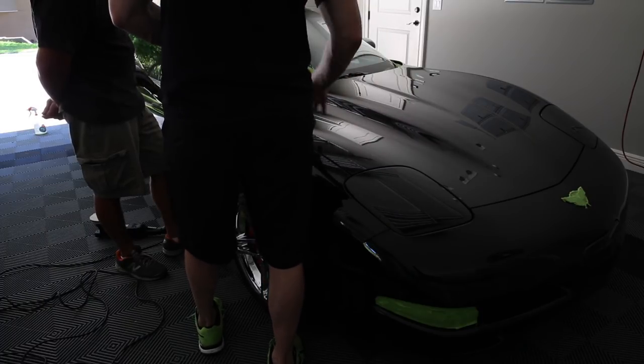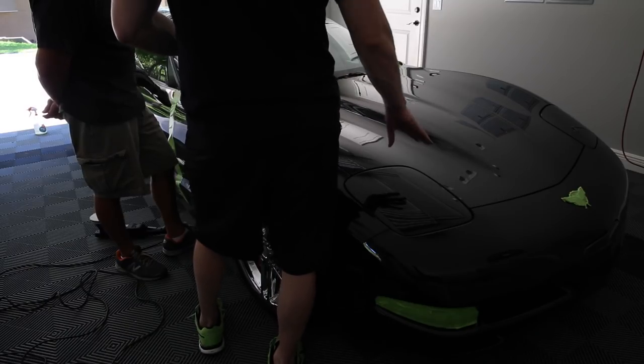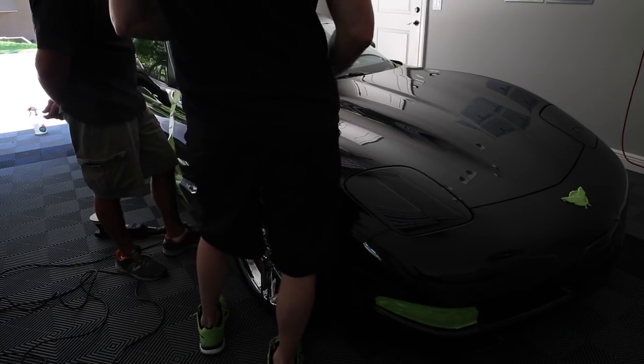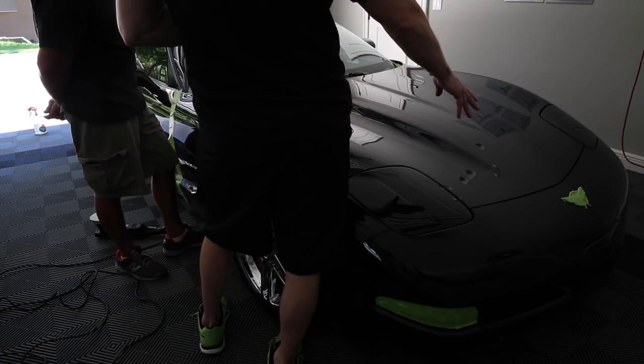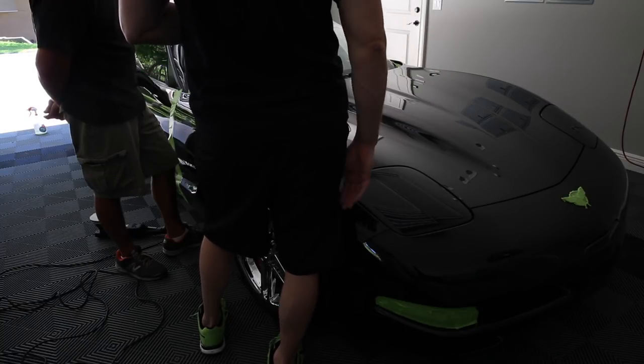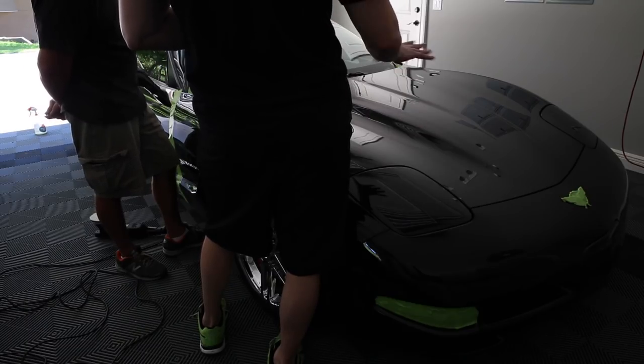And we want to overpass our correction spots a little bit, because usually toward the end over here, it didn't polish as good as I did in the middle. So we'll do 105 on the whole thing. You can use the 6-inch and I'll use the 5-inch. Okay. And you'll work on that side, I'll work on this side, and we'll dial that in.